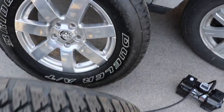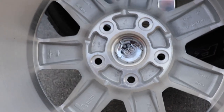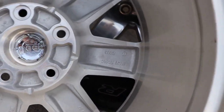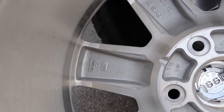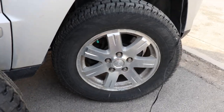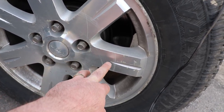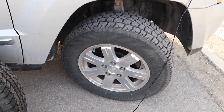While putting air in these wheels, I noticed you can take out the center caps — they're just pushed in. The offset on these wheels is 44.45, size 18 by seven-and-a-half. These are real Mopar wheels, not replicas. Versus the old wheels, which are a number of years old now — I started using them in winter, got stuck, tore up one of them, so I decided to give up on using them as summer wheels.